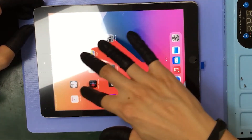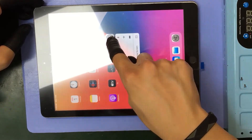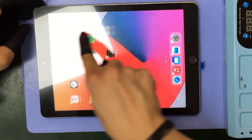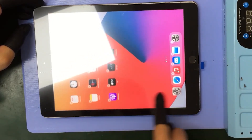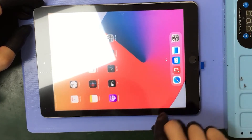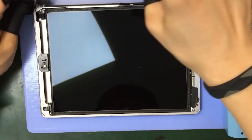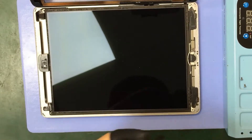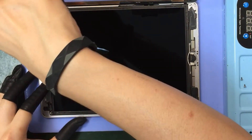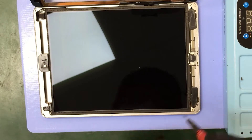Alright, it's powered up, so let's try. It looks like everything is working fine without getting any kind of touch error and the home button feels perfect. Time to screw on the rest of the screws and put some glue on the edges of the iPad. Clean up as clean as possible before putting on the touch glass.